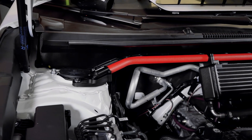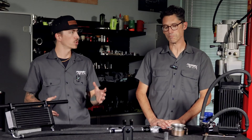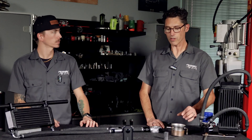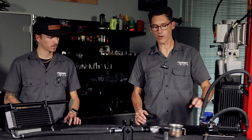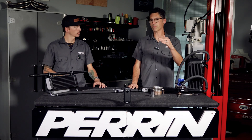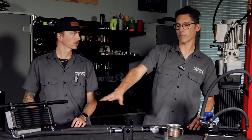We are now offering a top mount option for our oil cooler. Let's quickly go over what an oil cooler does and why you might want to upgrade from the factory one. All turbo cars come with a factory oil cooler slash warmer that just passes coolant through it, so your oil temp matches your coolant temp or runs hotter. Under high horsepower racing or sustained high load, oil temps can easily hit 250 degrees, which breaks down the oil, lowers viscosity, and reduces protection.